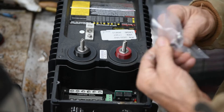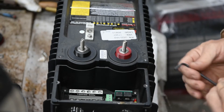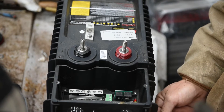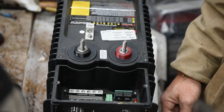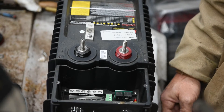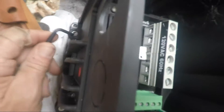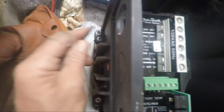Next we're going to take this Allen wrench — four millimeter — and take these eight bolts off. If you have a T-handle, that makes this job much easier. These are the Allen screws, they're four millimeter. There's eight of them around this: one there, one there, two on the ends, and then these on the other side. So I'm going to take them out real quick and then we'll show you the next step.